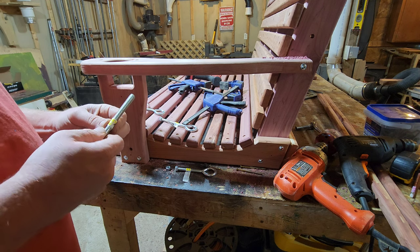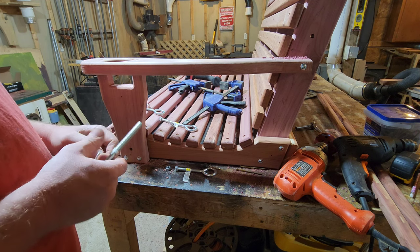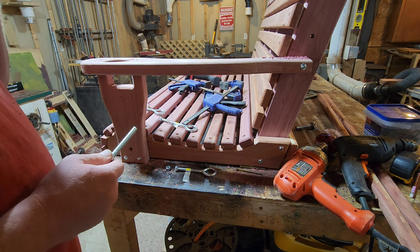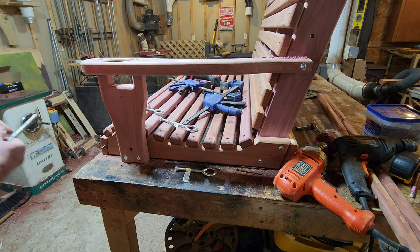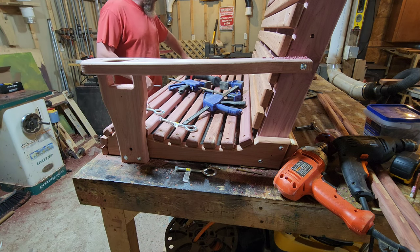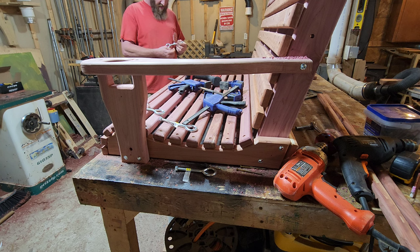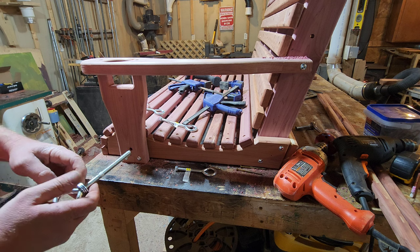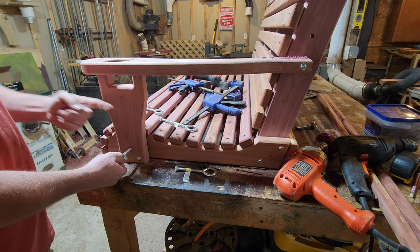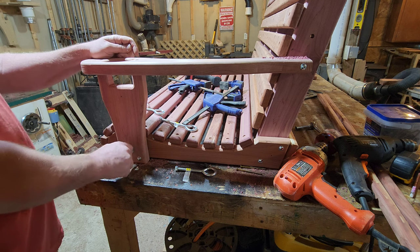Take my 3-inch here. And the reason I had those bigger washers in my little kit over here is because these things never come with washers. So that's what I use these for. I normally put about 2 or 3 here just to kind of boost it out a little bit. Make sure I clear that chain, comes up and clears this a little bit.